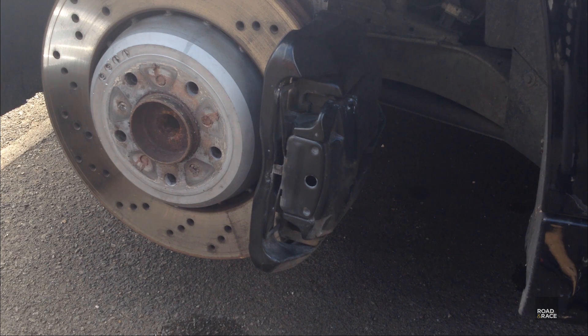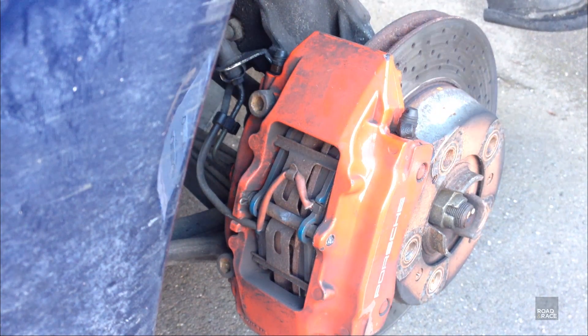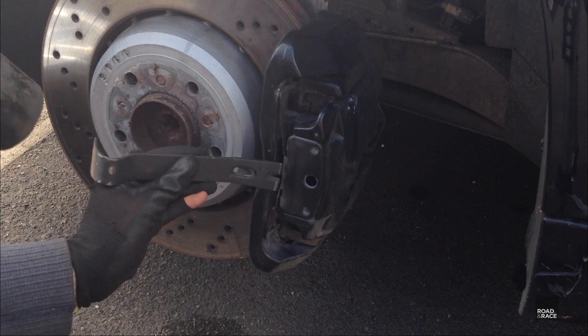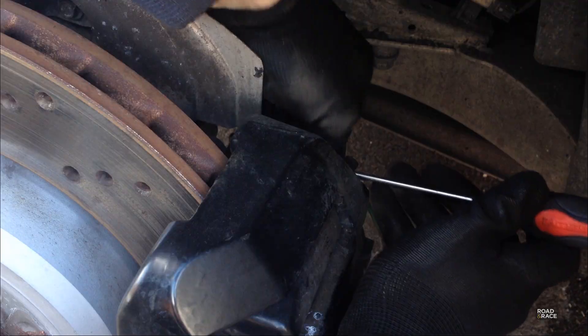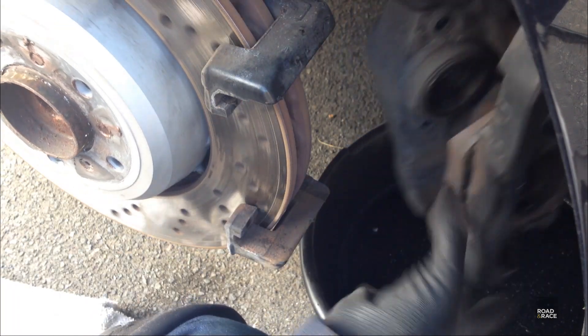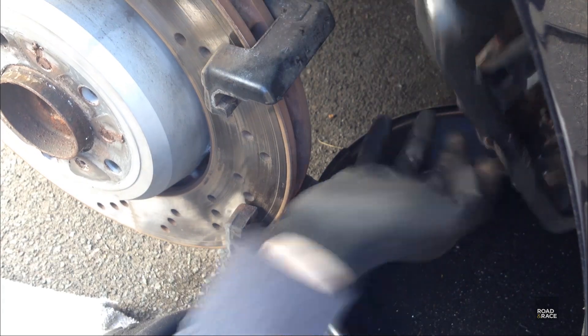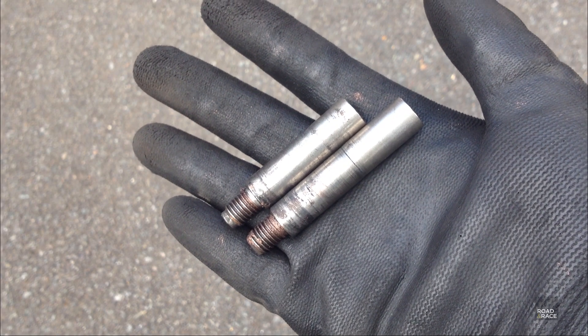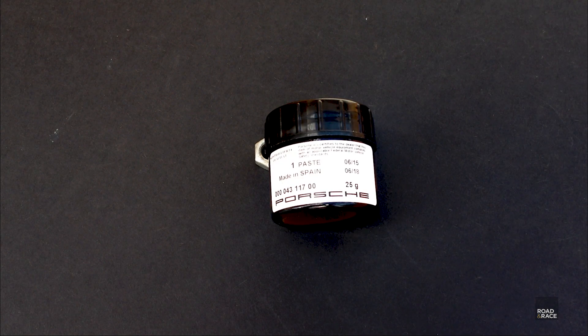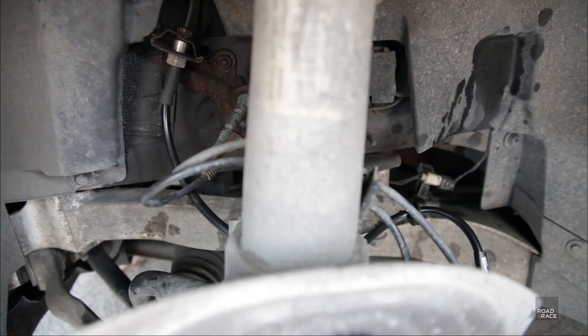I'm not a big fan of BMW's brake caliper design. On the Boxster, the Brembo calipers made it relatively easy to swap brake pads — just remove the clip, pin and sensor cable and the pad pulls out. On the M3 the whole caliper has to come off, which means removing the retaining clip, the brake pad wear sensor, two caps that protect the slide bolts from the weather, and the two slide bolts themselves — they have a 7mm hex head, don't you know. It's a heavy caliper and you'll have to support it on something to change the pads if you're not replacing the hoses at the same time. As the caliper slides back and forth on the slide bolts, it's best to keep them well lubricated. Here's the shot of the brakes with the new pads and brake lines fitted — I've also pressure bled the system by this stage.